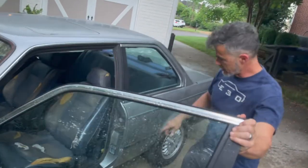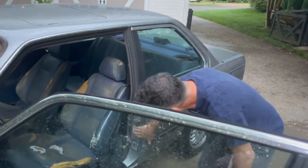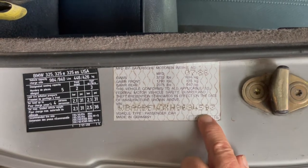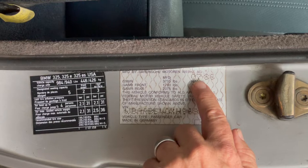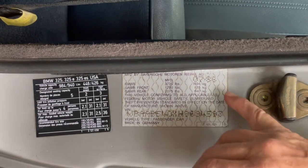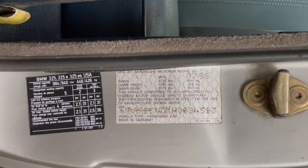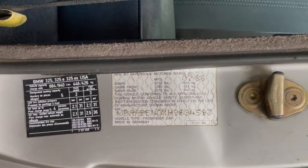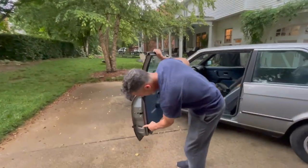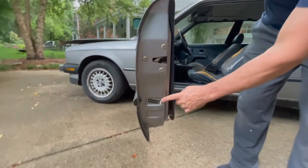The first thing we're going to look at is the VIN. Every car in the BMW E30 line has a VIN number — we're going to look at that on decals all around the car. Right here it says 07 of 86, so this was built in July of '86, which makes it a 1986 model year car. One of the first VIN decals we're going to find is on the end of the door jam, and it ends in 4593.